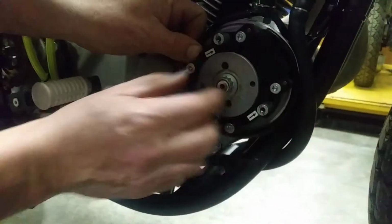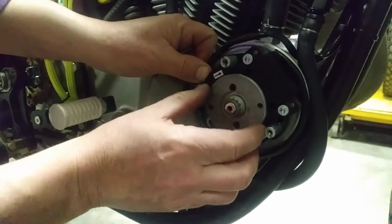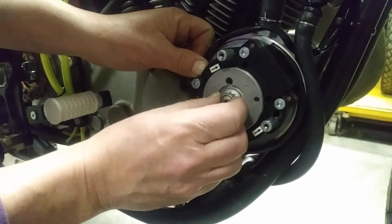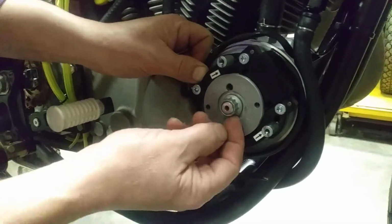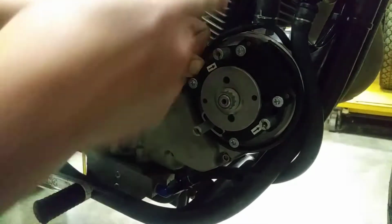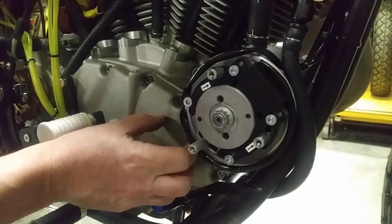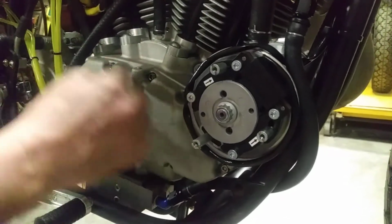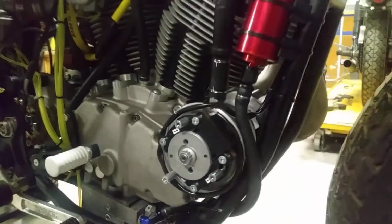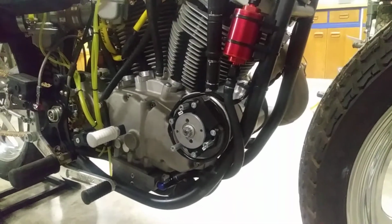You've got a little stator in here, a little flywheel inside your stator, and I've put these little 12-point nuts on here to make it a little bit easier to work on. The stock nuts aren't very good. Anyway, it runs with a shaft in here that runs across to the other one, and there's a little intermediate gear that runs off of the cam train and turns these things. They'll spin like 10,000 RPM, 10.5, and reliably.